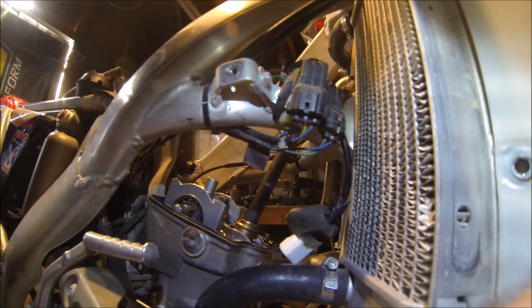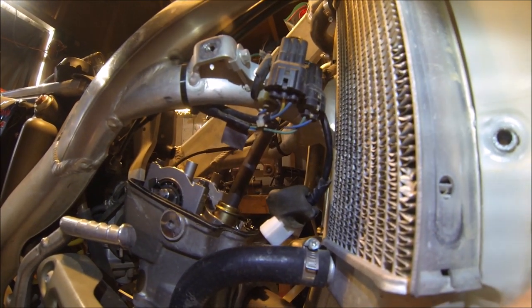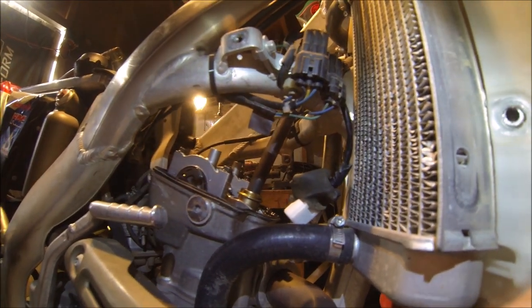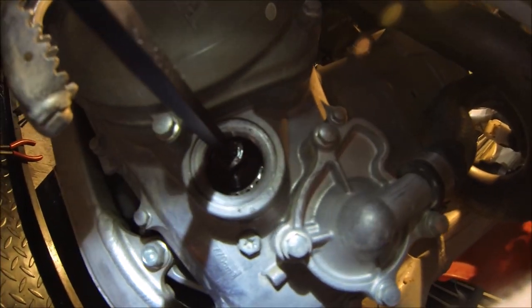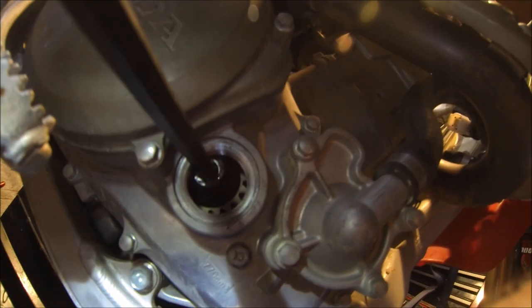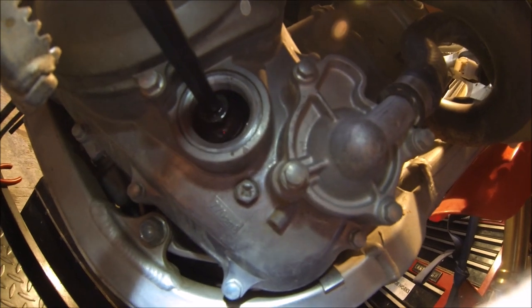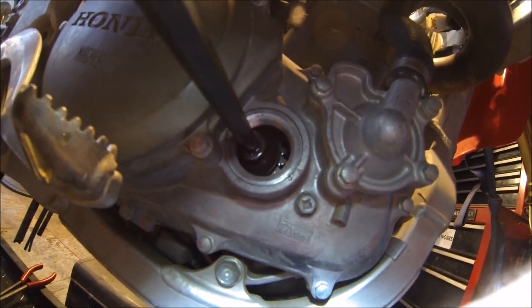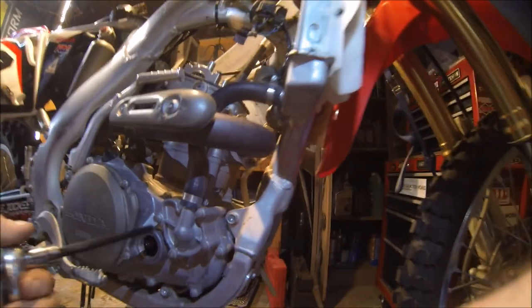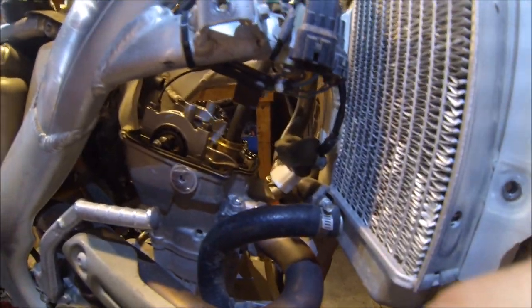Okay, just did something. Hold on, let's watch it. All right, so there's the exhaust going down. Okay, so now those just went, so now we're on the intake stroke. So let's come over here and look at our mark. Should be coming up. And there it is. Looks like that's it right there. That little click sounds like the auto decompressor valve is set up to line up the engine at top dead center.